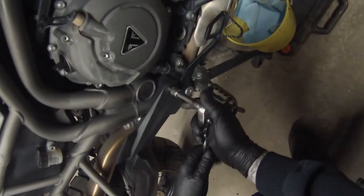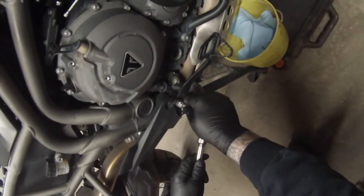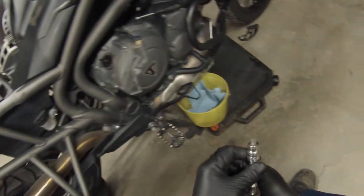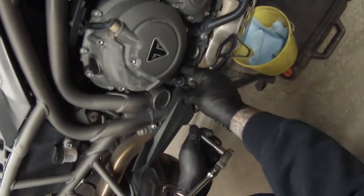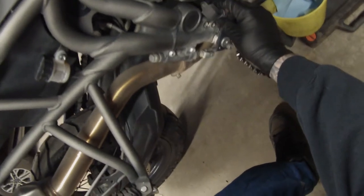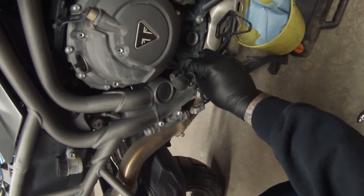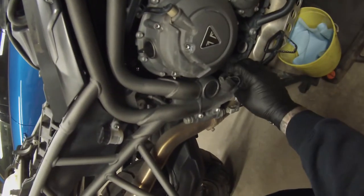Something that isn't in the work instructions — if you did actually pay for that Triumph manual — is you have to get this brake switch out of your way. You can see the bolt that's right behind it. In order to do that, it is just two T40 Torx bolts, and you're going to remove these two bolts so you can get this little cover out of the way and that switch will pop out. You don't need to fully remove the switch — just move it from there to there. I've still got the spring hooked up and now I've got really good access to that bolt.